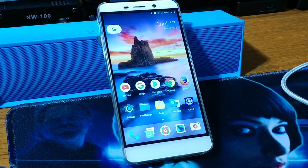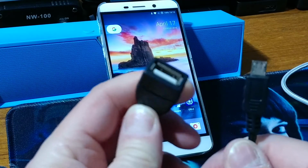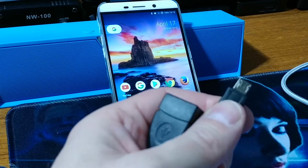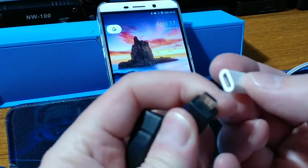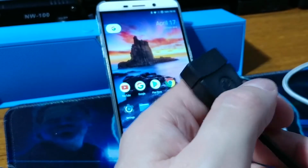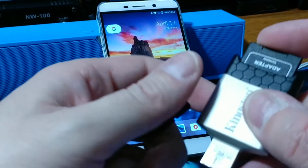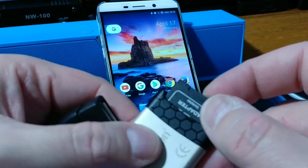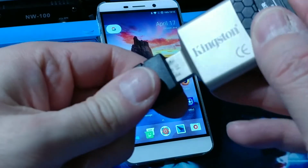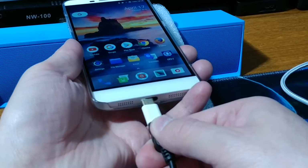So now let me show you how you can install this ROM onto your phone. First of all, you need a micro USB to USB connector cable. Then we need the Letv adapter which came with the phone, and we will use it to attach it right here, just like that. Alright, and then you will need the 3 files which I put in the video link below, where you can download them, install them on your SD card, put the SD card in the USB stick, and just slide it in like that. And let's go ahead and insert it in here.